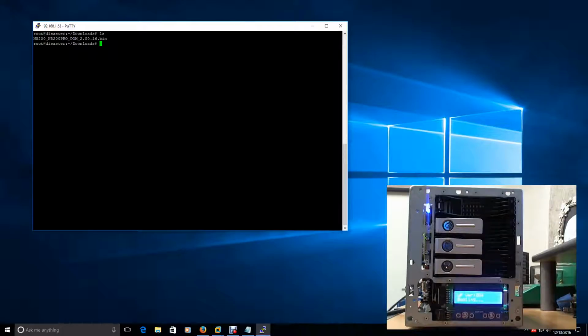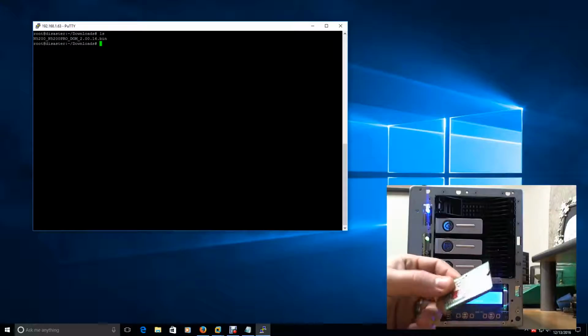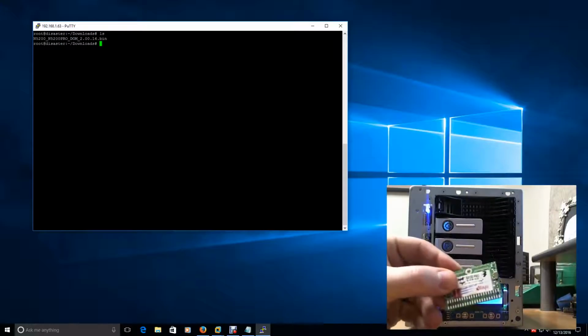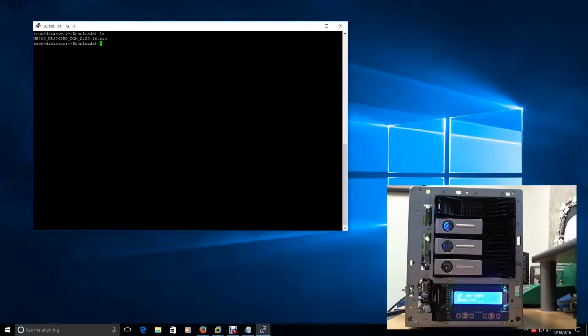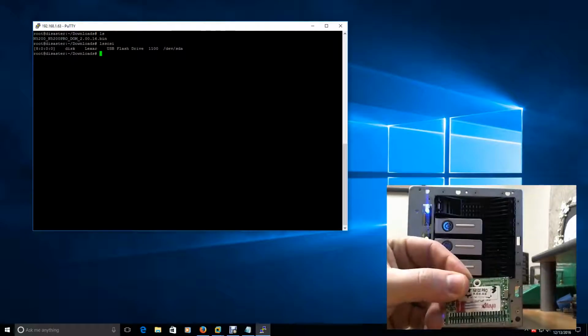So now that we have the firmware on the device here, on our little Linux that's running off our USB stick, what we want to try and do is put it on this memory card. There's a command in Linux that you can type in, and it lists all your devices, lsscsi for SCSI. That's letting us know right now it sees my disk, which is my Lexar USB flash drive, and it only sees that one.